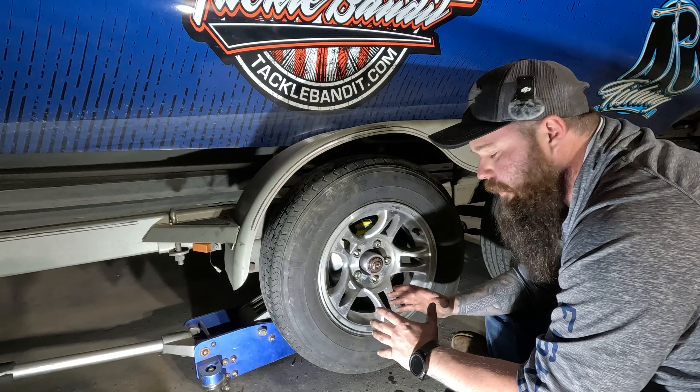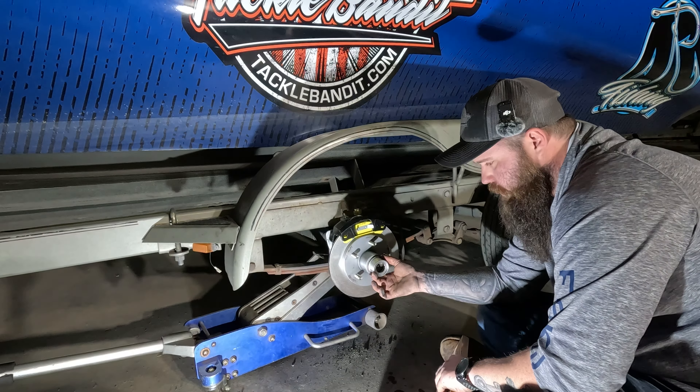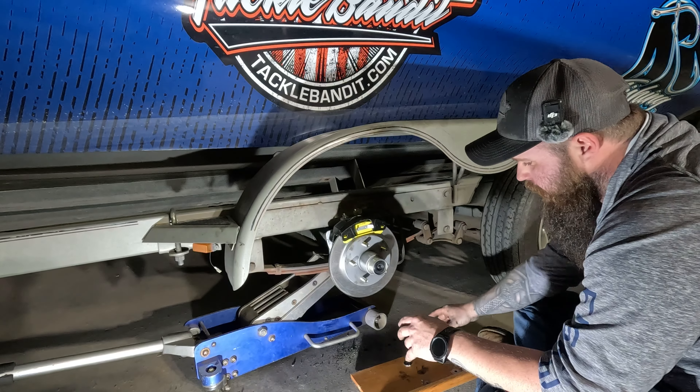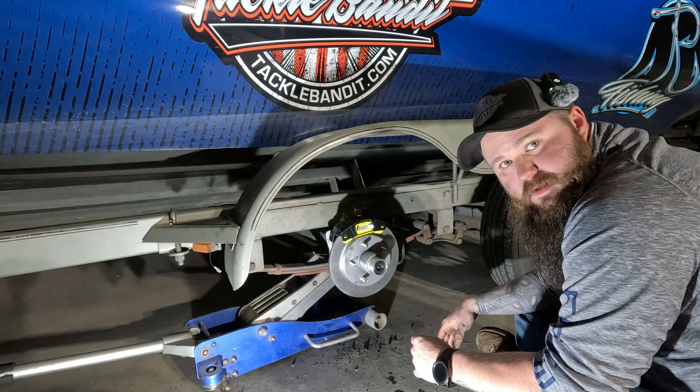The last thing we've got to do is knock on this dust cap. One of the important things to remember with boat trailers is not to over-grease them. When we bought pre-greased hubs, it is already loaded — for right now we're not going to add any extra grease through this zerk fitting. All that's going to do is cause that grease to expand when it gets hot and blow that rear seal out prematurely. It's important to get the cap started square and knock it in evenly, so we're going to use a scrap piece of wood to hold that in place and give it some quick little taps. Now we'll put our little rubber cap in.